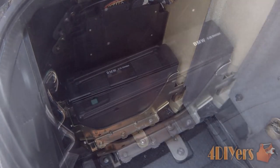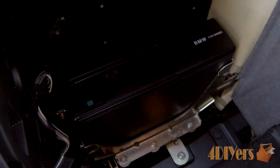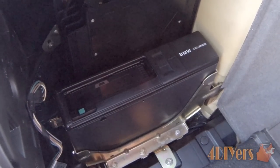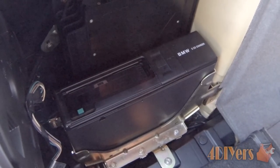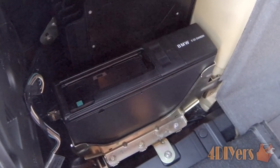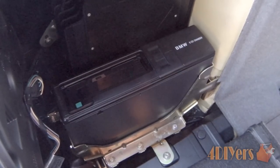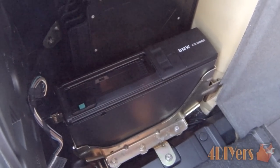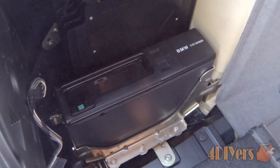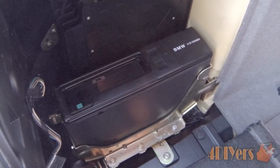One of the more common problems is with the CD changer cartridge. This cartridge basically houses all the discs — this one is a 6-disc changer with 6 slots that pop out to hold the discs. Over time dirt, debris, or oil can accumulate inside. There is supposed to be no lubricant; it should be perfectly dry and just a sliding plastic fit. The plastic assembly can also have little bits break off — the piece that pulls the disc out, or the side slots — which can bind up and prevent proper operation.